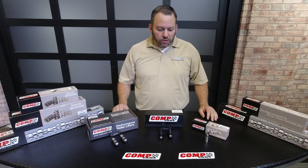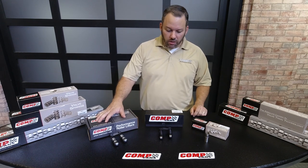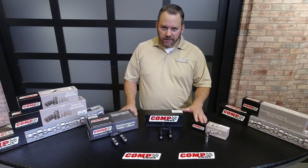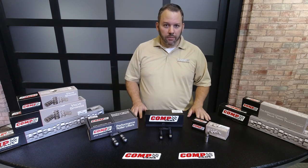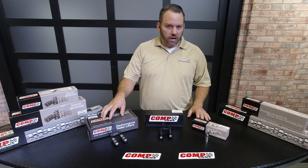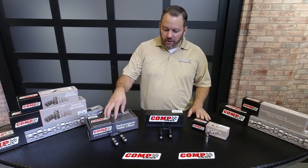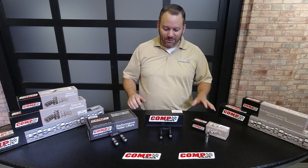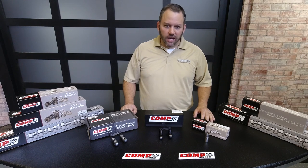So we've covered the important parts about all these different lifters: hydraulic and mechanical flat tappet, hydraulic roller, and solid roller. The most important thing to remember is clean the lifters before you put them in — clean them and soak them. Also, select the right lifter for your application — many times people use the wrong roller lifter, which causes failure and can tear up the camshaft, the lifter, and a lot of other parts. Please read the instructions — I know it's not a manly thing to do, but clean them, put them in, and you'll have long life on all of your parts. Thanks for watching.